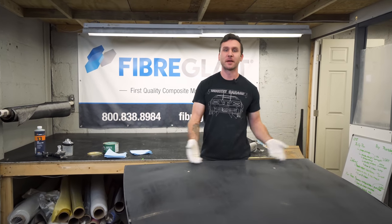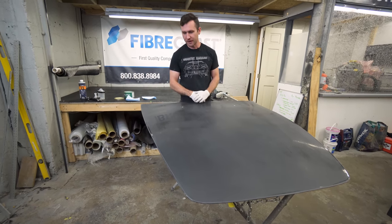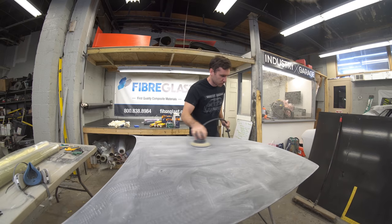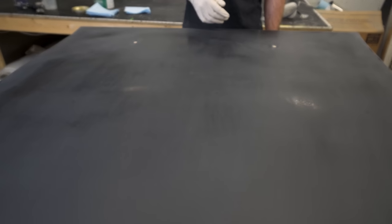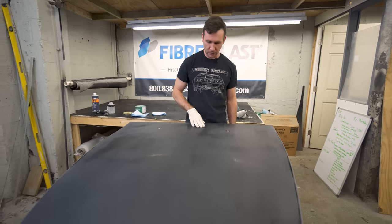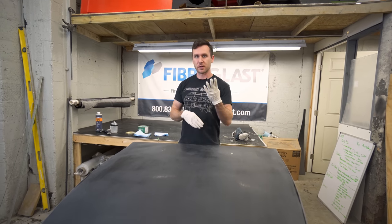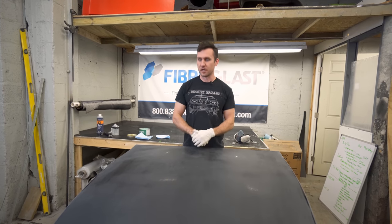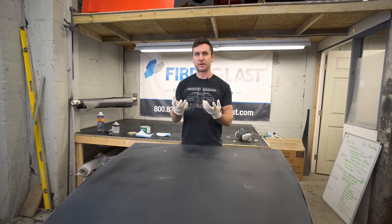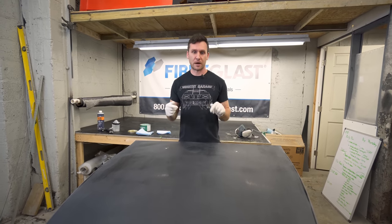So what are we making today? We're going to remake Xavier's S2000 hood. It's a fairly easy part — pretty flat. What I've done so far is just sanded the whole top with 1000 grit to get down some little dirt nubs in the paint. We're going to do four layers of 3K 2x2 twill carbon fiber and cut the skin off, then bond the carbon fiber outer skin to the bottom section of the actual aluminum hood.